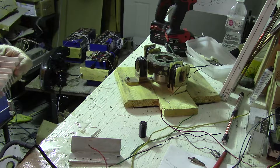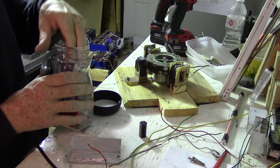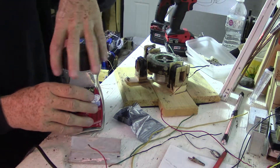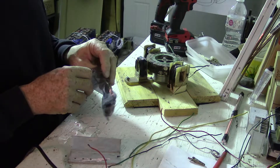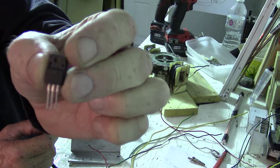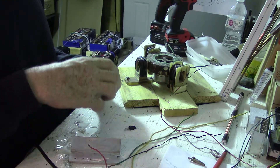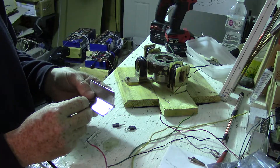These are the transistors here. These are the D224 ones — these are pretty good. They're not as good as the 56s, but these will do if you don't have any 56s. I don't ever use anything less than three — I always parallel three of them together. I'll show an easier way to parallel them.